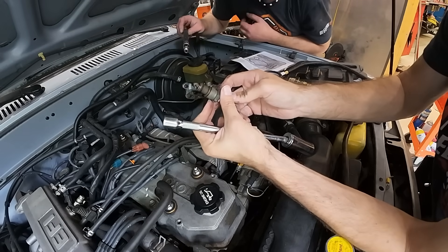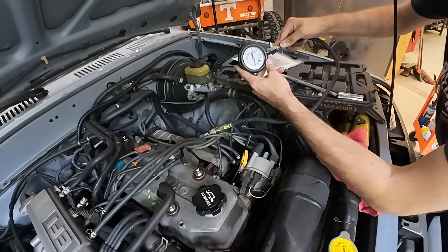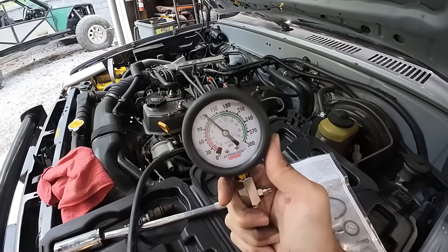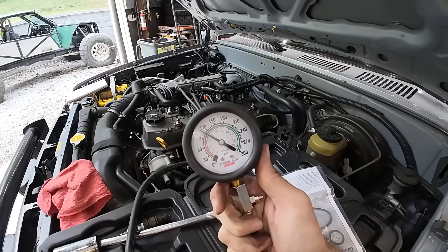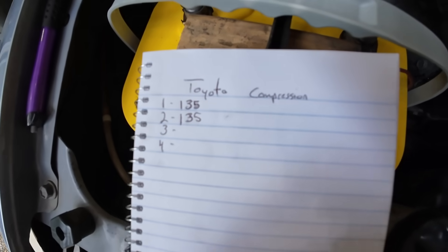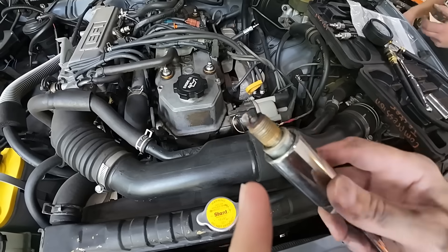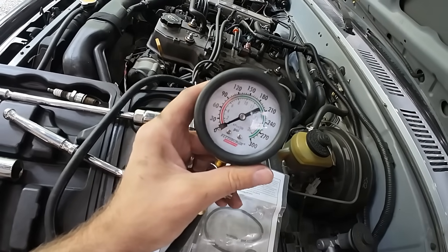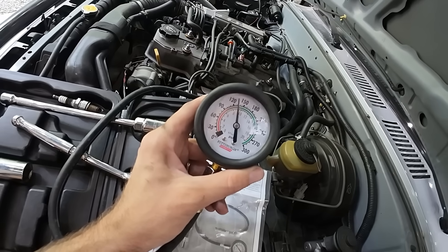Take a look at this one - the gap looks massive. It's still going up when you stop cranking, so do a couple more seconds. Yeah, 135. Oh my goodness, look at this third one - there's a lot of carbon buildup on the outside of that thing. That was disgusting. Number three goes... right between 120 and 150.